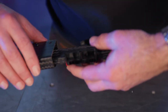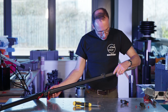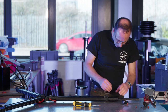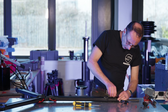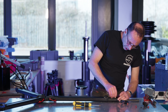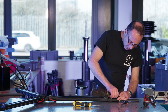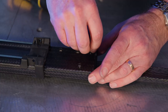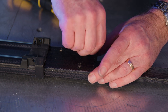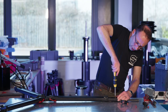Once it's slid in, put the brake back on and then put these screws back in. These screws are designed to make a thread in the plastic component inside, so it's always worth trying to find the start of the thread by starting it off with your fingers. If it's a new component, it won't have a thread in already, but if you're replacing the old one it'll be there. Then with your screwdriver, do them up.